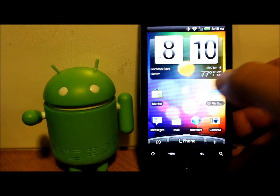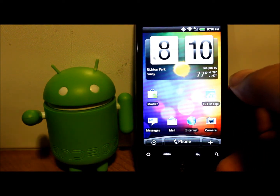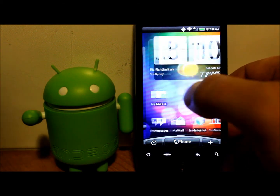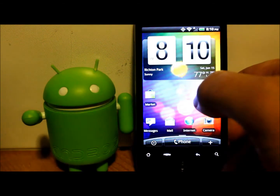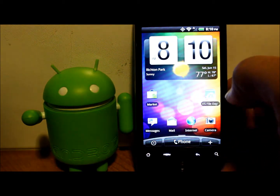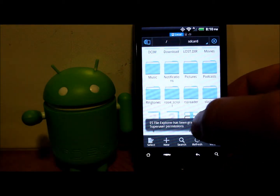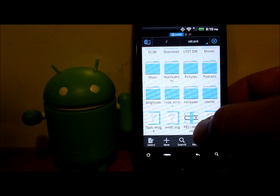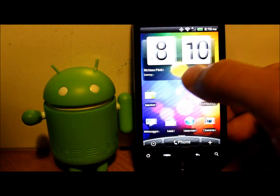Here's another fun little video showing how easy it is to flash stuff with S-OFF on your HBoot on your HTC Droid Incredible. If you have S-OFF on the device and your HBoot bootloader is S-OFF, all you have to do is download this little file right here, which is going to install TWRP recovery and replace whatever recovery you have installed.